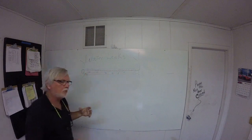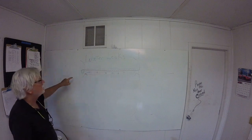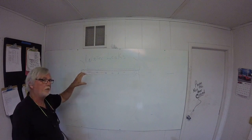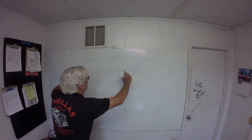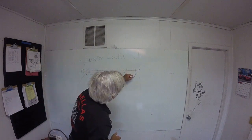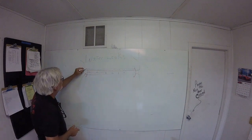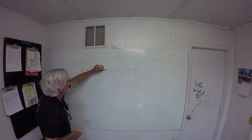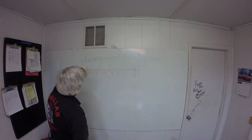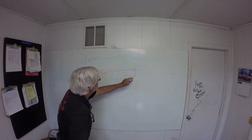Sealant is butyl tape because it can move a lot, okay, from front to back. The cap is a cover for the sealant. You see what I mean? Because it floats from the middle, it will float. And right here, you can have a lot of movement. Okay? I mean, right here. At this point, if it pivoted right in the middle, say it twisted right in the middle, at that pivot point, right there, it can move that much.